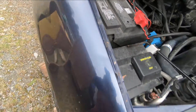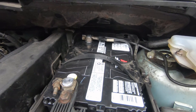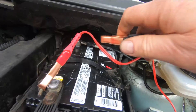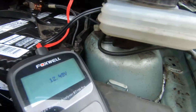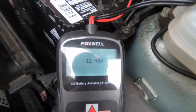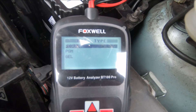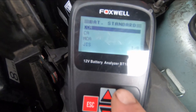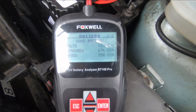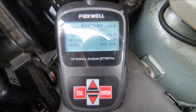The last one I'm going to test is the brand new battery I put in the Mazda 5. I haven't done a thing with this battery — it came right from the store, and I haven't started the vehicle. So putting positive on here, negative down there. It says 12.48 volts — that's right up, that's a full charge. Battery test, in the vehicle, regular battery, 550 cold cranking amps. And it says: good battery. Volts: 12.49. Measured 674 cold cranking amps, rated at 550. Like I say — brand new battery, it's going to read like that.